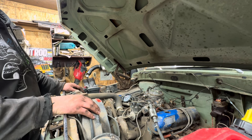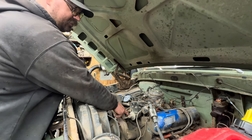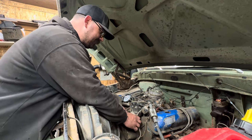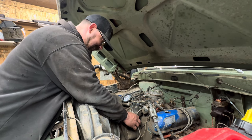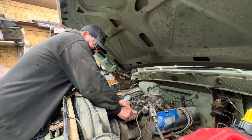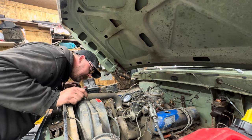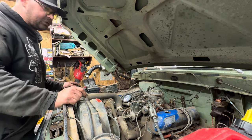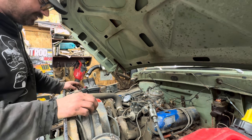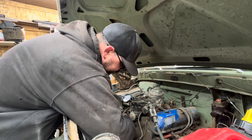This will actually spin. Fords never want to turn. Generally, they like coolant down right onto the distributor and seize it right to the motor. I don't know, it's been a good truck for us so far. Nope, it's not gonna move. Well, we're gonna say the timing is perfect, which is probably it. It's terrible. Oh well. I guess we'll try and free that up.